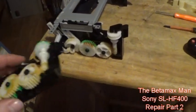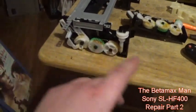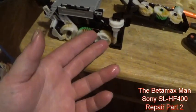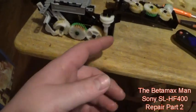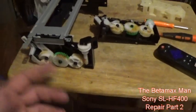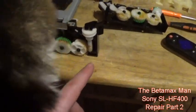I was taking a look at the gears here - I pulled the gears completely out and it took me about an hour but I finally figured out what was going on. This is what holds the worm gear in place, and because there's a chunk of plastic broke off missing from that area, it's causing that to pop out, jump a tooth or two, and then the cassette housing goes out at an angle with one side farther advanced than the other.